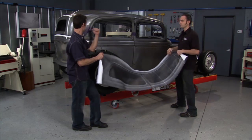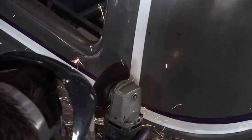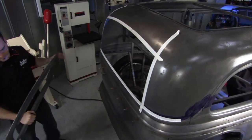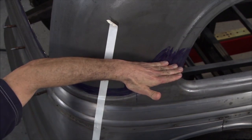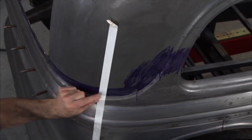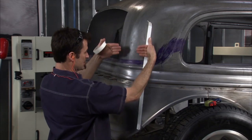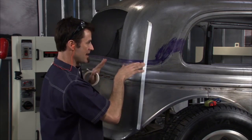So let's get that done — you cut that, I'll cut the rear window out. We'll be on. Got the rear window out. Now we're trying to lay out the cut through the C-pillar. You want to miss this radius and miss this radius and try to get the flattest area you have, because that's going to be the easiest place to chop it. Once we take this little three-quarter line down, we need to do a kick up, get this cut, drop it down. We'll kind of slide it inside the body and then line up to Bird's pattern.